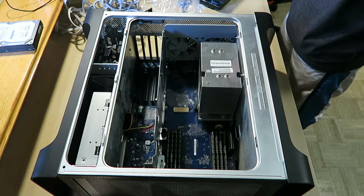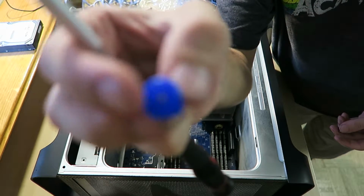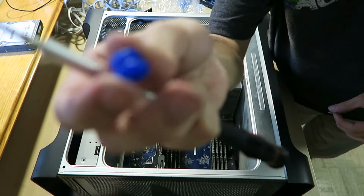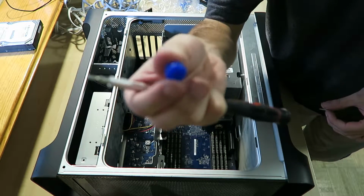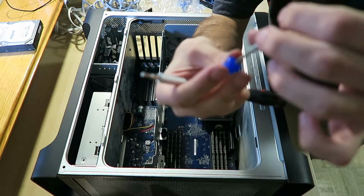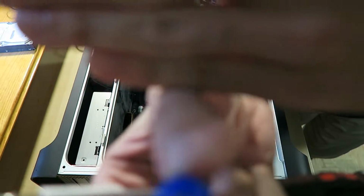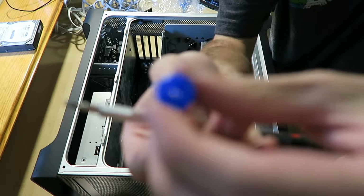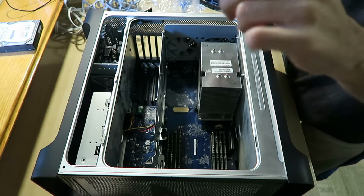See this? You know what this is? It's a little shock absorber for the CD rack inside the optical drive, the little tray that pulls in and out. This is there so vibrations don't scratch your CD or interrupt the reading process. And look at this. The screw sits on it perfectly. Come on, focus. Whatever, it fits on perfectly. If I pull this little thing off, the screw will come out easily. So I can just pass the screw onto that, and when it's done screwing, I'll just pull the little plastic out.